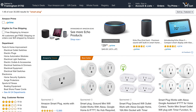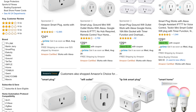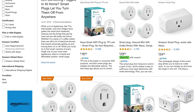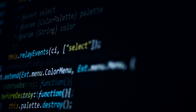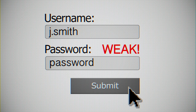It's enticing to save some money and buy a no-name brand for $5 versus the $25 for a brand you're familiar with. The problem is that each of these devices are little computers running basic operating systems. Not every company takes the time to build out their systems with the care and attention they require, so they may be running outdated software with security vulnerabilities that were never patched, or have default administrator usernames and passwords which make it easy for a hacker to take control and run amok inside your home's network.